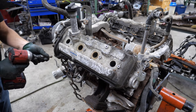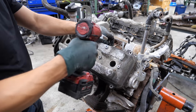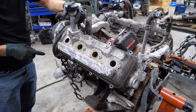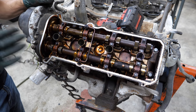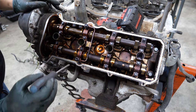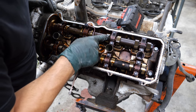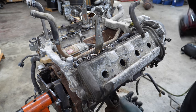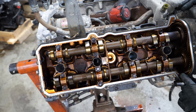Let's go ahead and get the driver's side valve cover off. It's pretty dirty — doesn't look like it's been very well taken care of. Not terrible though; I've seen much worse. There's not like huge oil deposits everywhere, it's just pretty well varnished. The cams look good, at least the lobes do. I don't think there's any water or moisture in here. Same story on the other side — no major deposits, just pretty varnished, no signs of debris.